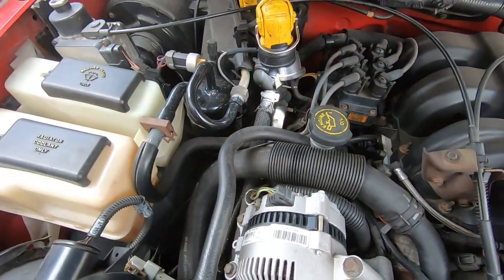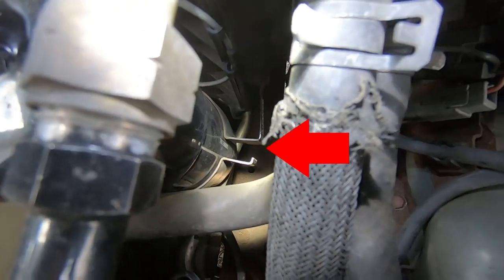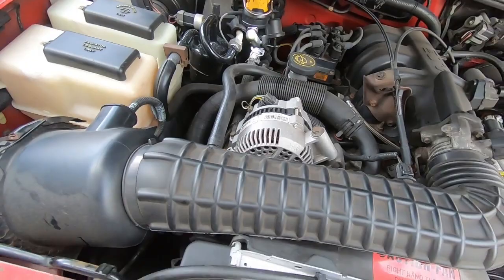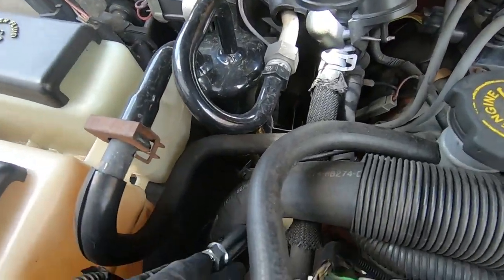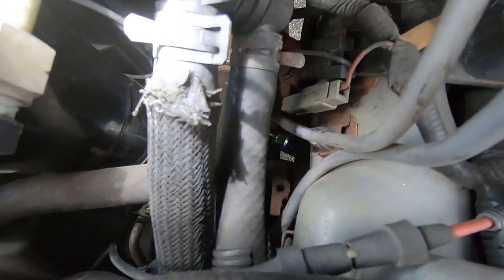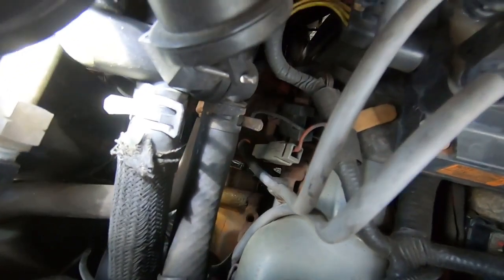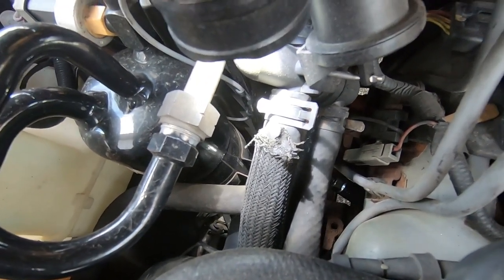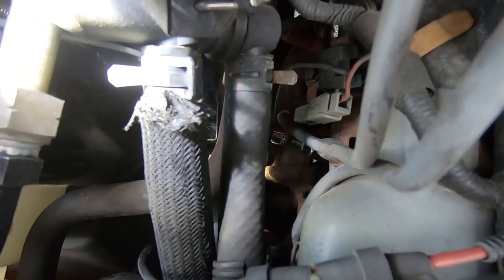Wire is off, now we just got to get the plug out. Using the same setup as the first plug — the two inch extension with the socket wrench — it's a really tight fit due to the AC bracket right there. So the best combination I found here is a 3/8 drive little wobble socket, it's probably about an inch. Going in the same way under the radiator hose and dropping this on — it gives me just enough room to sneak the socket wrench in. I am on it, perfect fit, and broke it right loose.